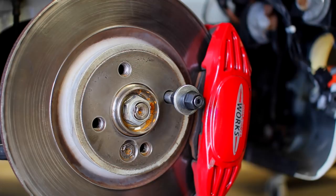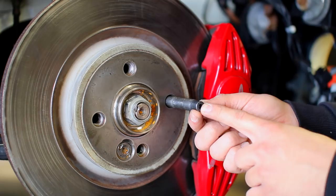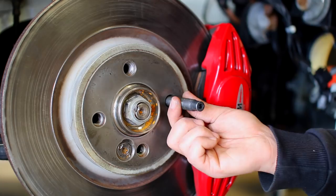So here we have one done, three to go. Note that on the end of each stud there's an open end for a hex bit. If you have a hex bit that attaches to a torque wrench, you can use that to torque the stud in without putting the locking nut setup on. You'll still need someone pressing the brake pedal to keep the rotor from spinning, but it's a quicker method.